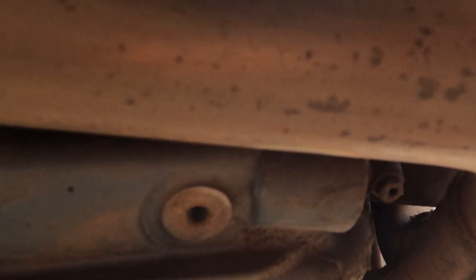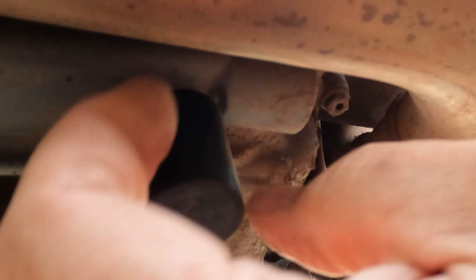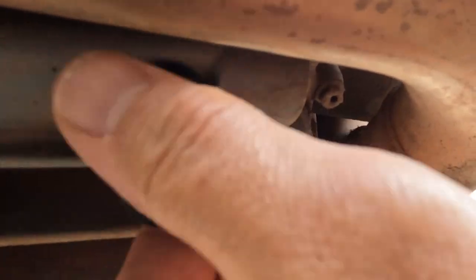The next step is going underneath the engine. I've got my bike up on the stand and I've just put some blue thread lock on this bung. That just screws in there — it's just hand tight, there's no other way of screwing it. But the bash plate will hold it in place.